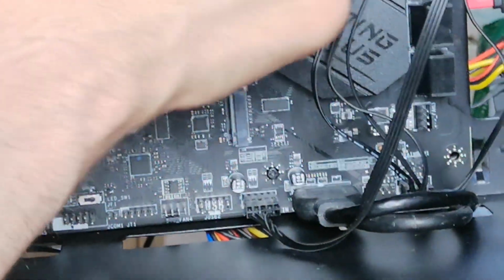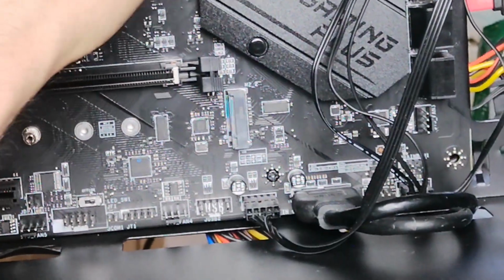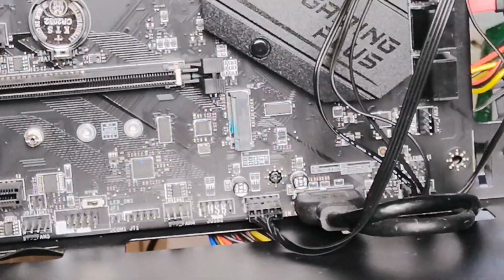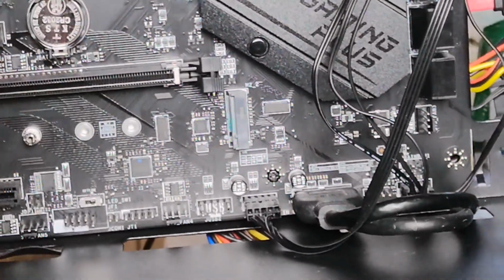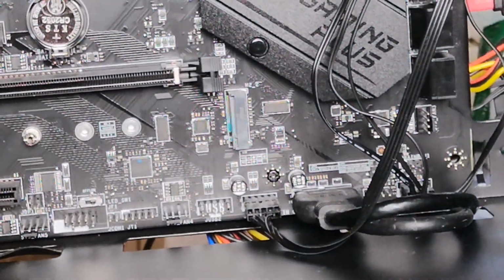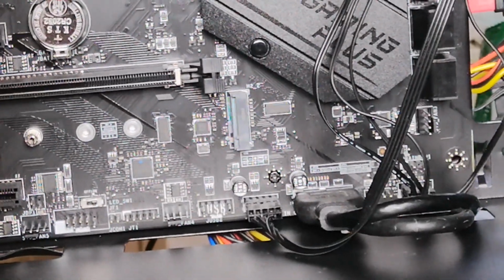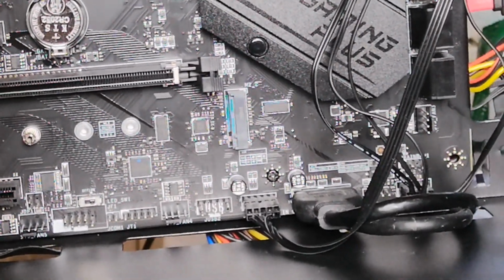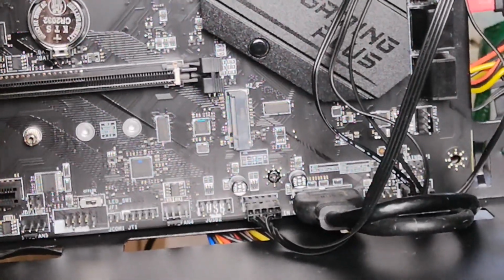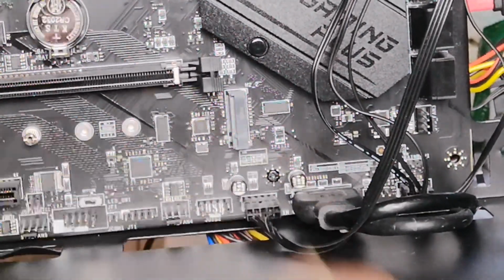I've also plugged my power cable in, the main motherboard power cable from my supply. Put my AMD Ryzen 7 5800X3D CPU in there. Those are just thermal pads. I'm going to now put in the water cooler device. I've used a device to convert from 4 pin to 8 pin, converted the CPU power. I'm now going to put in my RAM memory.